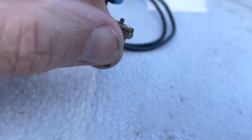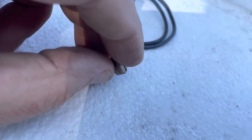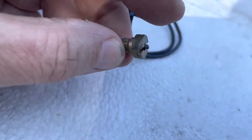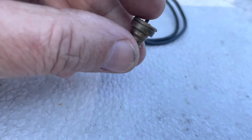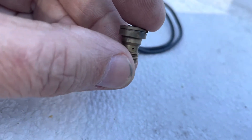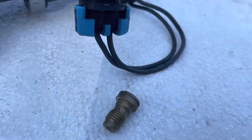There's a little spring-loaded button right there. When you push it in, that spring-loaded button opens up and allows fuel to enter this power valve. The fuel enters through around this valve right below my finger and comes out these tiny ports right here in this power valve. That's what adds extra power when you're under load, and that's why it's called a power valve.